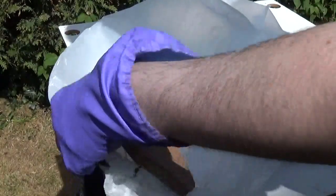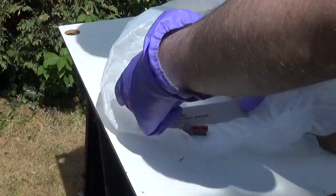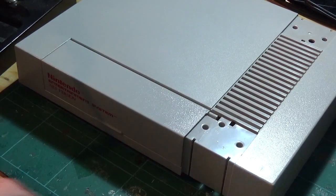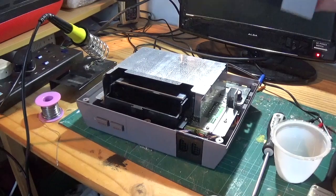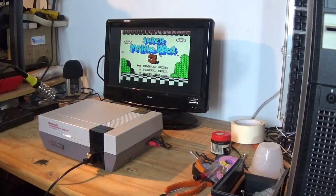So it's been about four hours — let's see how our yellowed plastic parts are doing. I think they're about done. Just need to thoroughly rinse any peroxide residue off, and after fully drying we can reunite the case door with the main shell. The color is a perfect match once more. Just need to refit the tension springs to hold the door in place, then with the other outer trim refitted, the two halves of the case can be reunited.